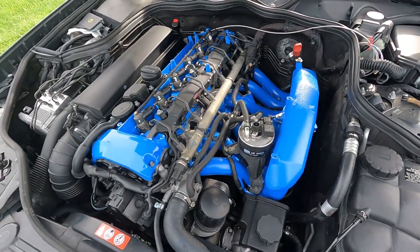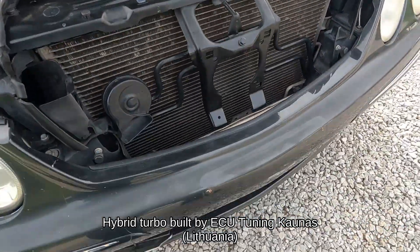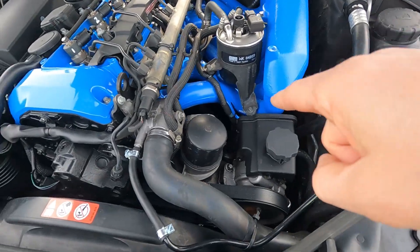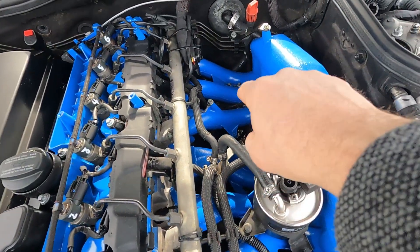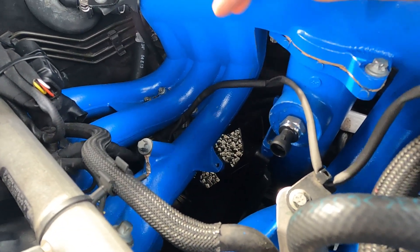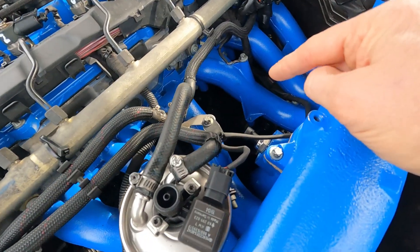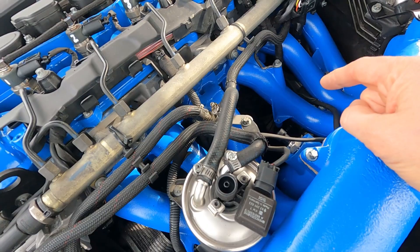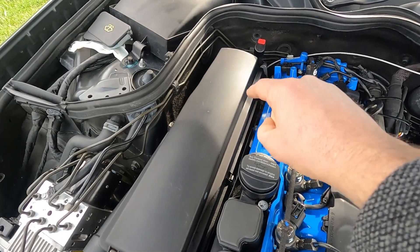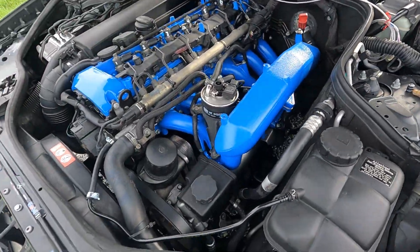Some paint work was done on the engine — that's just cosmetics, everything looks pretty now. What you can't see under here: we've got a hybrid turbo, the oversized Mishimoto J-Line intercooler, a cleaned-up intake, no resonator, no EGR cooler — it's been blocked off and the mixer inside has been removed. The swirl vanes have been removed as well, and there's no more motor for them. There's a lot less clutter under the hood. And there's no catalyst underneath and the exhaust system has been opened up.